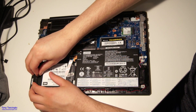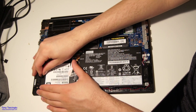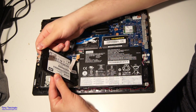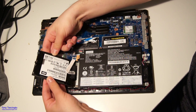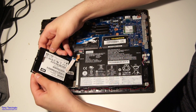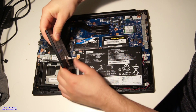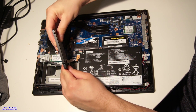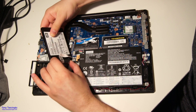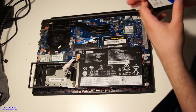To remove the SATA SSD, you just pull on this. You need to pull here because there's a little clip — pull it towards this way and you can just take this out. Popping this in and out is easy; this is just like a rubber enclosure. There are little pins that go into the drive. Then you can unplug the ribbon cable — be really careful, the ribbon cables are fairly delicate. And that is how you take out this SSD.